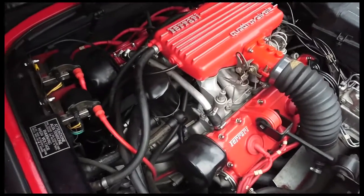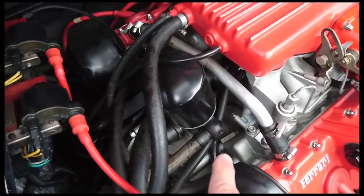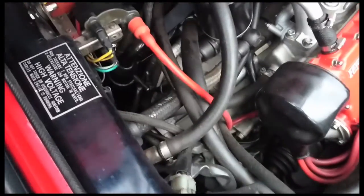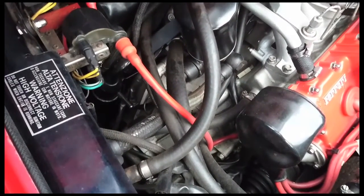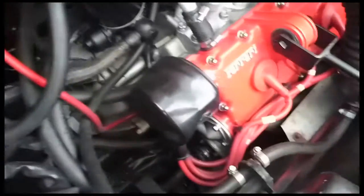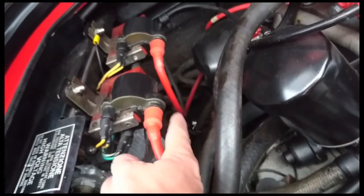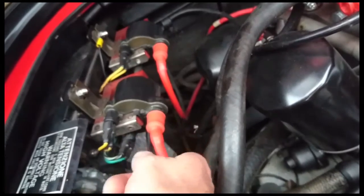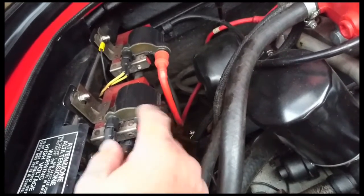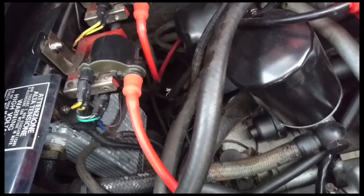Now why that is, I don't know. It's not the coils. I don't think it's the crank sensors either, because as you know there's one just there and another two around there — they would be misbehaving all the time, it wouldn't just happen at idle. My nasty feeling is that it could be either a plug in the digibox that needs pulling out and putting back in again — there are two digiboxes — or one of the boxes is going south. I don't know how they fail or what pattern they fail in, and I expect there are some people on here who know all about them and will be able to tell me.